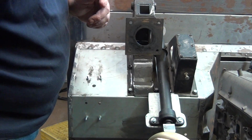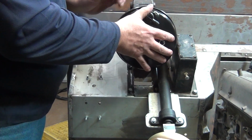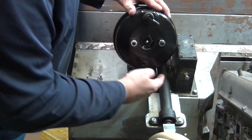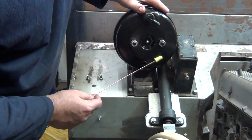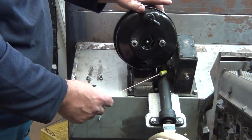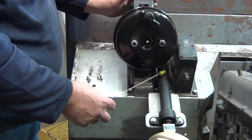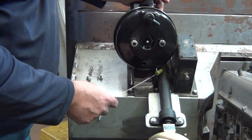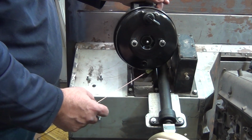But the problem with both the Type 50 and the Series 3, because we're trying to squeeze this down underneath the Series 1 hood, which is about here, if we keep dropping this down, where's my pointer? Both of these boosters are very quickly going to come in contact with the steering column. So we're not going to be able to drop it down, because we still have to drop down, I don't know, another inch to 2 as we work our way down little by little, making small modifications as we go. So under here we've got a little bit more to drop down, maybe 1/2 inch at the most, before we start hitting the steering column, because it's pushed over right by the steering column.